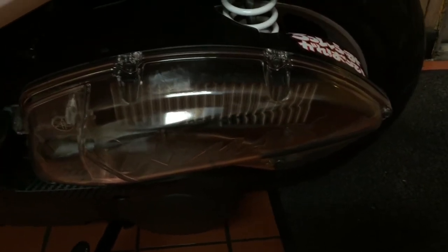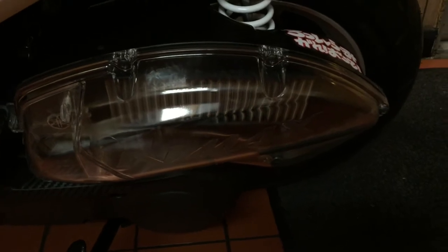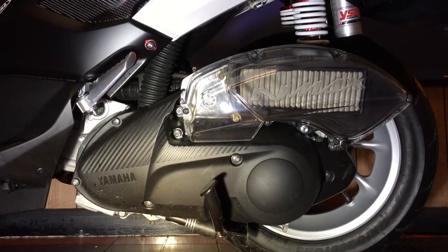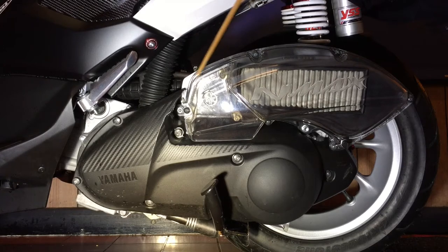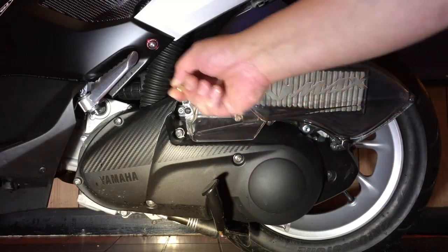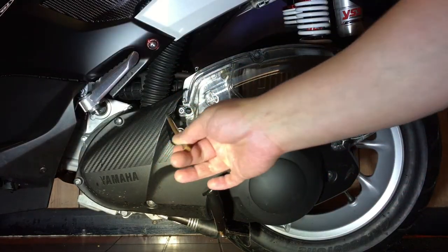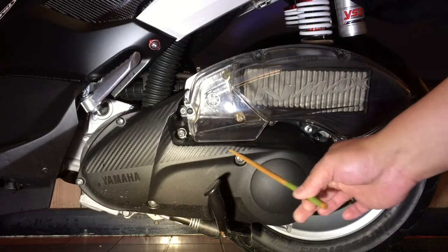Now let's have a look at the design of the air box. Surely if it rains the stuff's going to get in there, and if it's sucking in air, there's dust, dirt, dead leaves, and debris everywhere in the atmosphere. If you're traveling on the road where every vehicle in front of you is kicking up dirt, surely it's going to suck in dust. So let's look at how it stops that — how it's designed on this scooter. This entire section is an air box — it's very large. This is just the front cover. It sucks in air from the bottom — there's a very narrow gap along here.